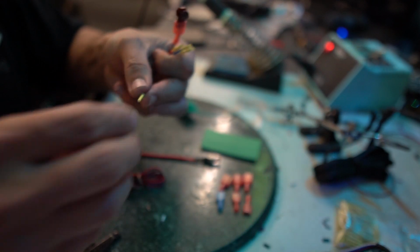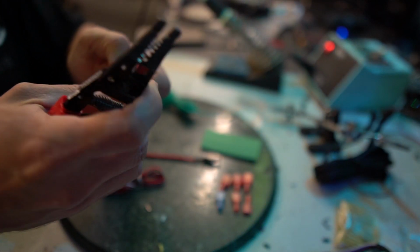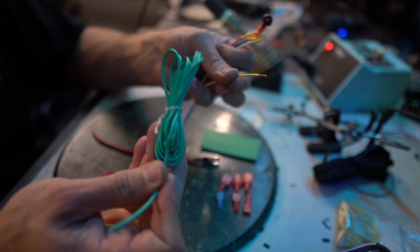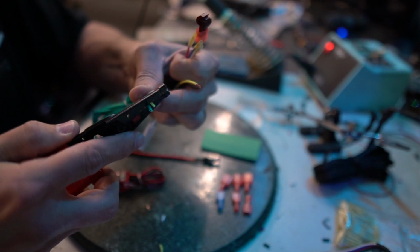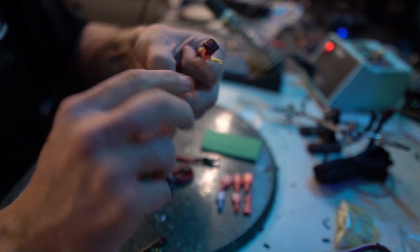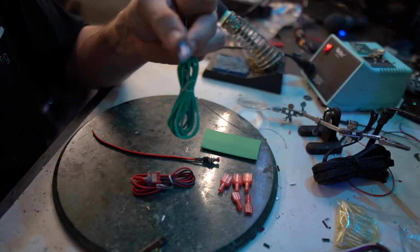We can forget about that wire now. And the last one is going to be our output wire. That is for the LEDs, the LED bulbs, whatever we want to power the third brake light. We're going to connect that with a wire to go over to the second tail light. We can also send this, like I said, to a third, fourth brake light, whatever we want. And because we have a slightly bigger connection there, 2 wires, we're going to use a slightly bigger connector that fits those 2 wires inside of it perfectly.